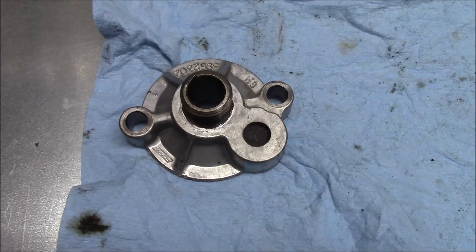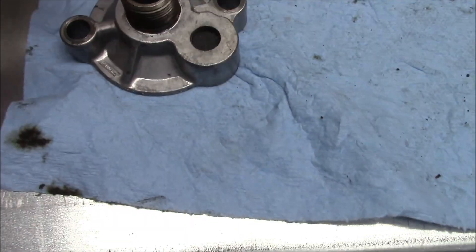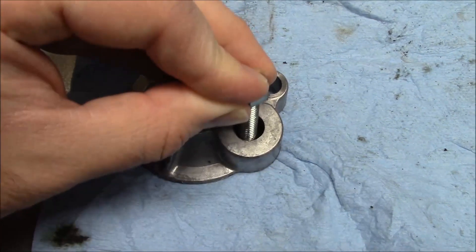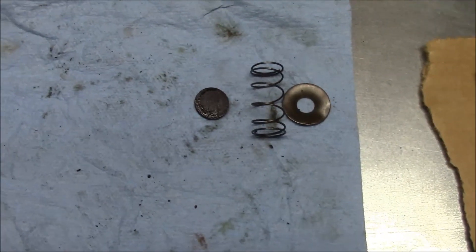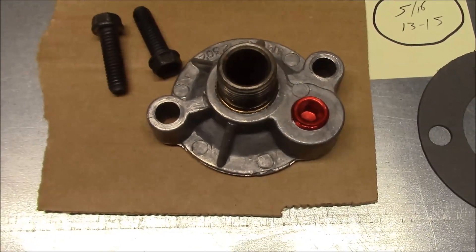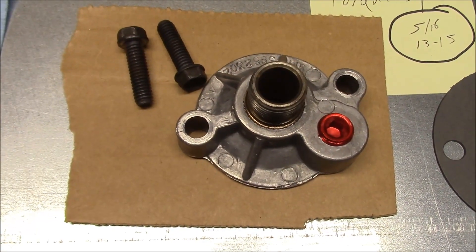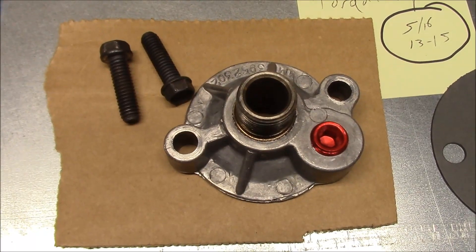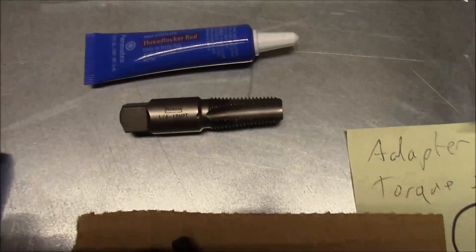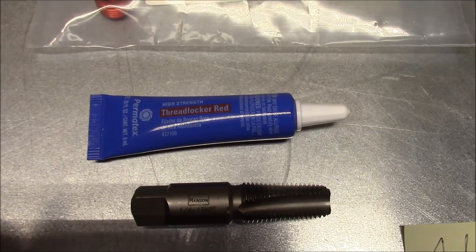Here's some quick info: I'm changing to one of these older style oil filter adapters that have a bypass valve. An old performance trick is to remove and plug that bypass valve — I've removed the valve and plugged the adapter. This modification should only be done if you're going to use the vehicle in warm weather and let the engine warm up thoroughly before revving it, otherwise you can burst or blow off your oil filter. To do this mod you need a quarter-inch NPT tap and quarter-inch NPT plugs. I used red thread locker because I don't want it coming out — that stuff is kind of like liquid weld.